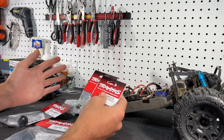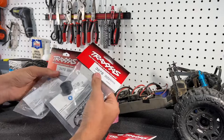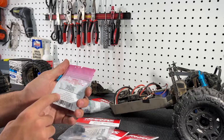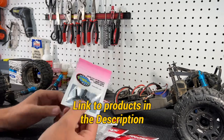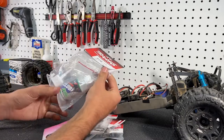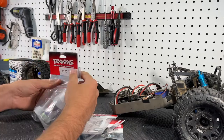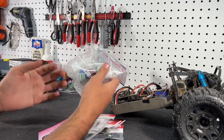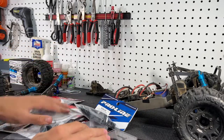To do the X01 diff mod in the front and the rear, you need the internal gears, two diff cups, and M2.5 x 0.45 x 12mm socket head cap screws — I'll put a link to all these products in the description. The last thing you need is new diff lube if you don't have any on hand. I like running 30,000 weight — it's perfect for all my stuff and basically the stock diff weight. So that's everything we're going to be installing: the X01 diffs, the new Pro-Line hub, and the new ring and pinion gears.